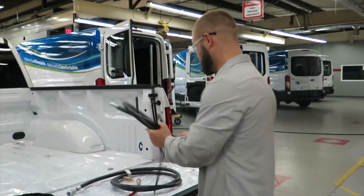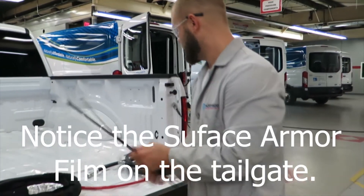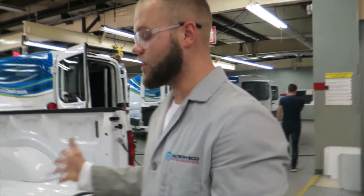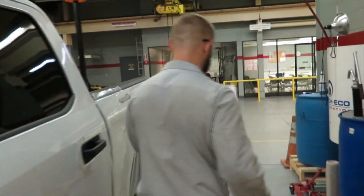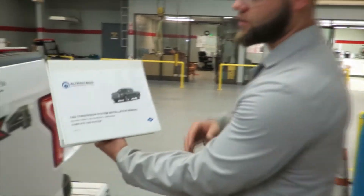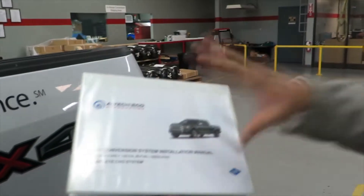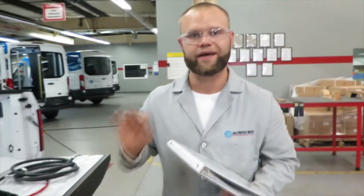Please do not place your parts on the floor — both for safety reasons and because you can break a part if you do. Everything I'm working with will stay here; I'll get to the other parts when the time comes. Our next step is to mark out the cylinder mounting holes in the back of the bed. I have the CNG conversion system installation manual — you follow it step by step. Personally, when I convert I like to prep all my holes: I'll drill every hole on the vehicle and touch it up with rust-proof paint.